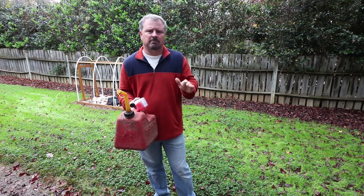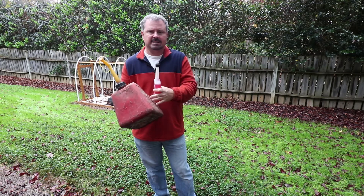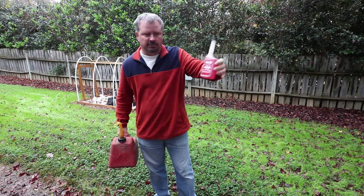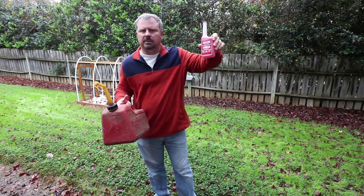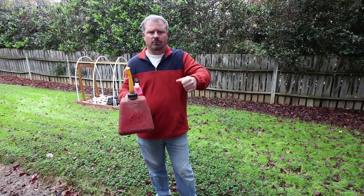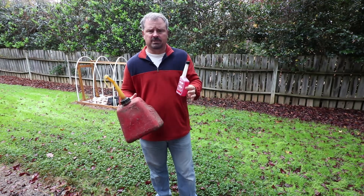So I just store all that stuff empty. If there's gas in my mower, typically I'll mow and I'll chop up all the leaves and I'll run it out of gas. And then in my gas can — this is a two-and-a-half-gallon gas can — if you use this Stabil stabilizer, this is the one I've always used, I'll link it in the description of this video. Whatever gas is in this, I'll mix the appropriate ratio — this is like one ounce per two-and-a-half gallons. So I'll mix that in the appropriate amount and then I'll pour some of this mixture back into my mower and run it for just a minute to get that mix in the carburetor. And then all my fuel is stabilized for the winter, so when I crank my equipment back up in the spring, it's good to go.